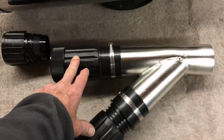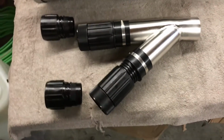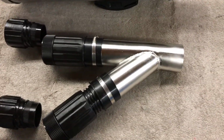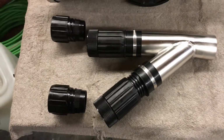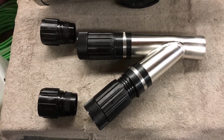So it's basically 2 2s, which is not 4, but you can qualitatively call it 4 down to 2. So there's very little flow restriction, especially on the way back, which is the way we need to look at this. Air flows back this way, right? So it's like hitting a big open channel when the air hits the Y. It's like home, easy sailing from then on.